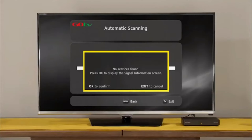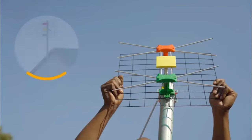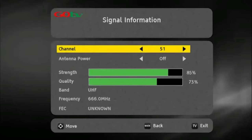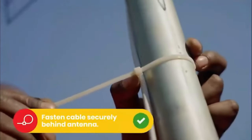Do not interrupt the process. If no signal is found, it will automatically take you to the signal detection screen. Insert the channel number for your region. This can be obtained from the GoTV website. At this point, you may need to rotate the antenna to maximize signal strength and quality. Use the on-screen bar to help fine-tune. Once you've optimized the signal, firmly tighten the antenna into position.